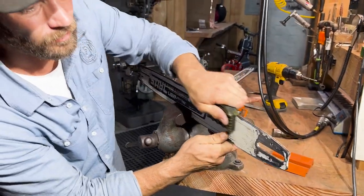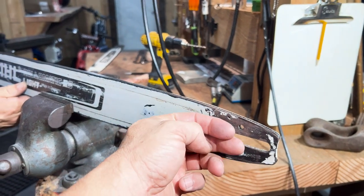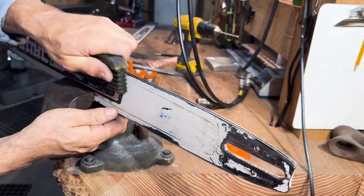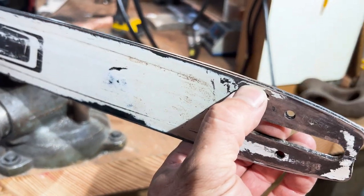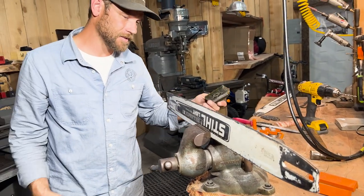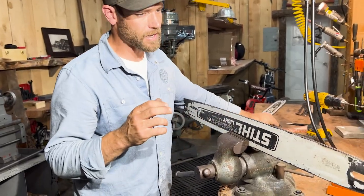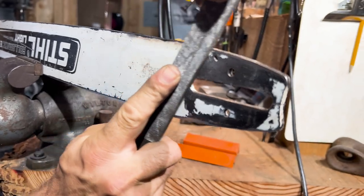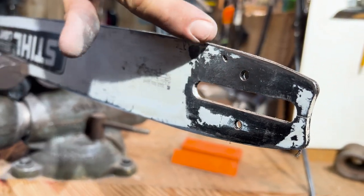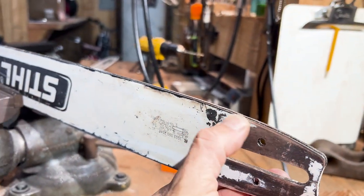Some of them don't need any tuning at all, but a couple of thousandths can make a difference — you go to bolt the clutch cover on and it pinches the chain so it won't spin. It's an unfortunate manufacturing oversight; they're making thousands of these so things slip through. If you get a brand new bar, put your flat file up flat against the edge and run it out — you'll see right away if it has that concave. It's usually right in the oil hole area.